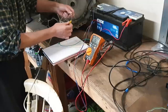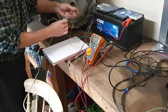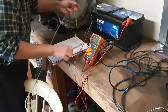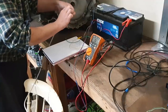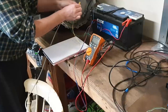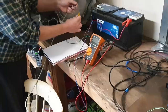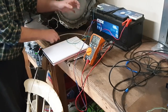So next up is the yellow wire. Let's see if we can find a match for him. No, right, I think the brown possibly. Yes, yellow plus brown is equal to, in this case, 16 ohms. Again, we'll take our yellow and our brown. That kind of leaves us then, it has to be the green and the red as the last pair. Indeed it is. Green plus red is equal to 16 ohms. Right, we'll just twist those now, just so we can have our three pairs. Now, that is step number one.